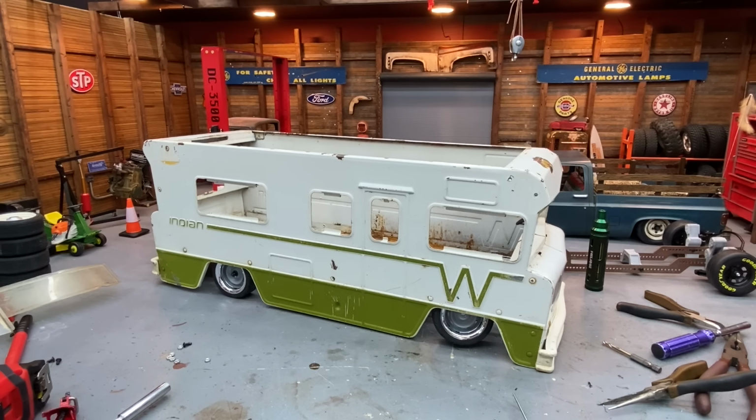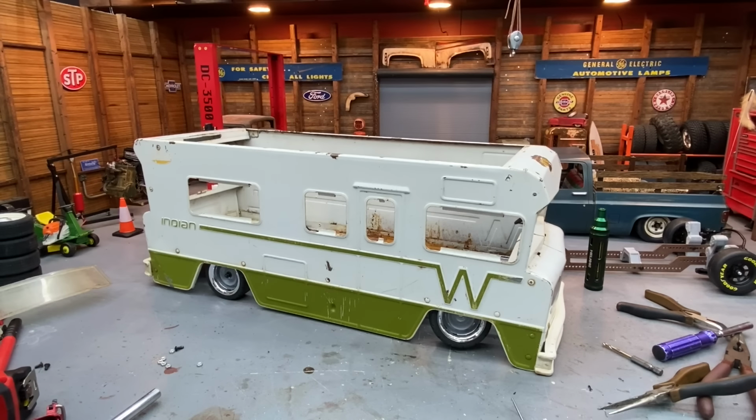I kind of don't want to do a dually now. I don't know. We'll have to try out some tires and wheels once we get it rolling. But I do have that Tamiya semi-axle. The stock axles are not the most scale-looking. They're kind of square, but you can mount the leaf up on top of or under, and they're the same width as mounting points as pretty much everything leaf spring RC related. Just ordered the axle today. It'll probably be a week or so before it gets here.